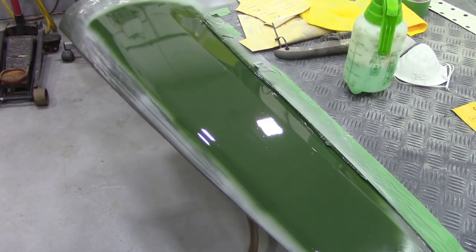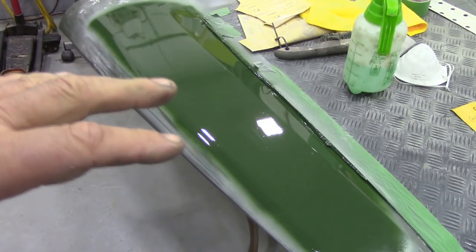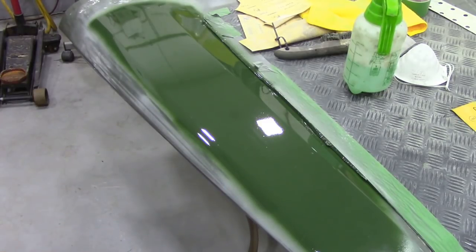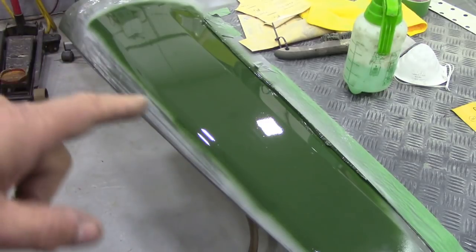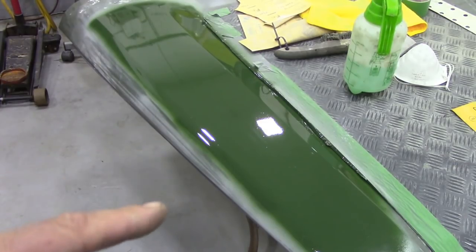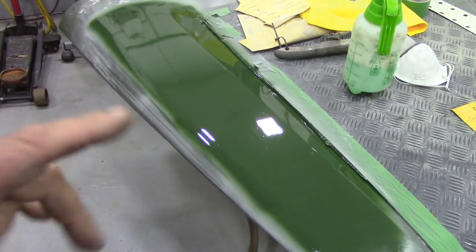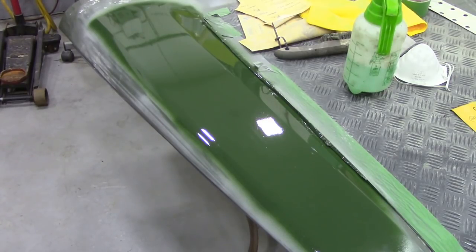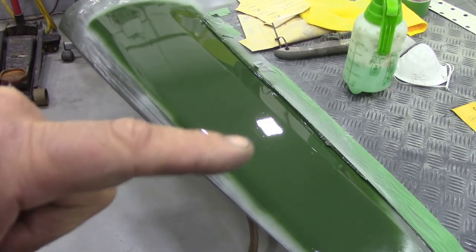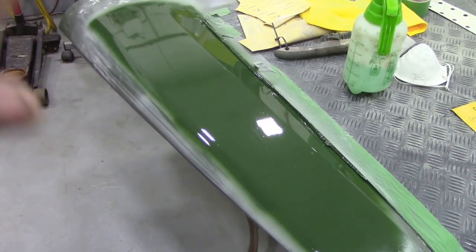This is a couple of days after the last few scenes. To speed things along, I gave it a coat of epoxy primer on top of the evercoat which was nice and flat. Then I put a coat of what I thought to be Coniston green - which it obviously isn't - on top of the primer. I didn't rub the primer down because you're going to make more work for yourself. We're going to use a light coat of top coat as a guide coat, just like we did using the guide coat on the polyester filler - epoxy primer and then a two-pack paint on top.